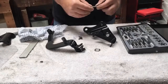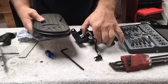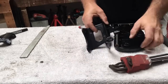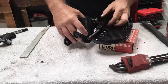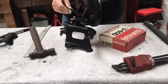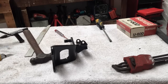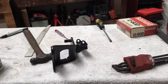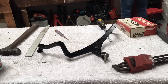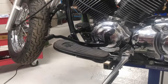Same treatment for the gear shift - rubbing it with a bit of scotch brite, getting it all cleaned up, then grease it up and put it together. Rebuilding the foot pegs - there was powder coating in the thread too so I just tapped it out. These screws and springs are tricky little things, very awkward to get in, took a long time fiddling around. Interestingly, the rubbers you put on the gear shift really benefit from being heated up - if you get a little mug of boiling water, drop them in, let them warm up and you can squeeze them over.